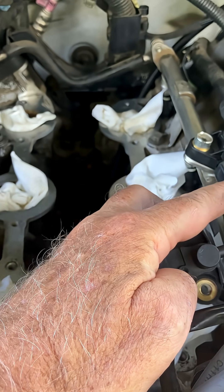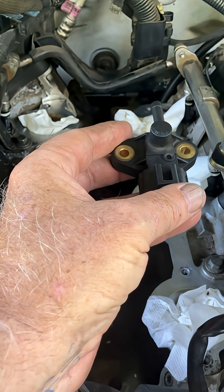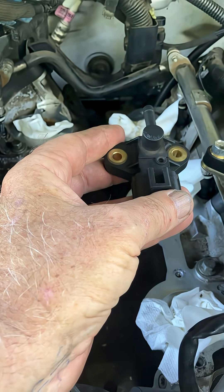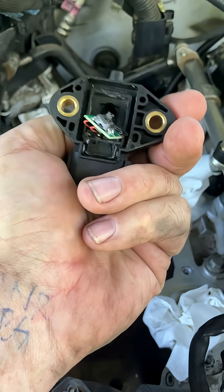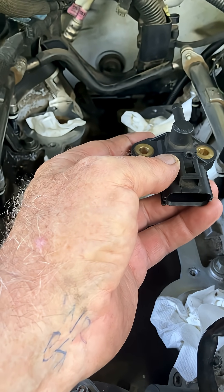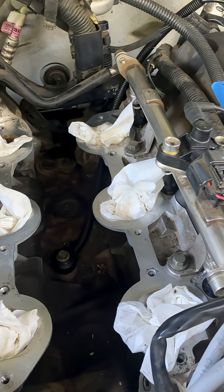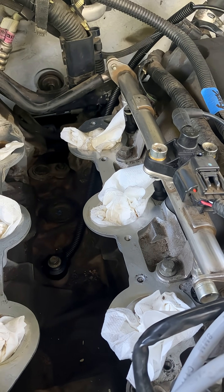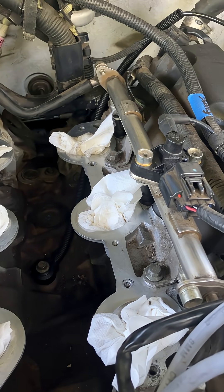Get the Motorcraft. It's quite a process to get the intake manifold off, so don't put yourself in a difficult position by using an aftermarket part. These are a complete disaster and they're all over Amazon. Don't buy the aftermarket fuel rail pressure sensors — find the OEM part. In my case, Motorcraft. Buy that. Five times the expense, but it will not fail on you. And if it does fail, you'll just throw a code and you can replace it.